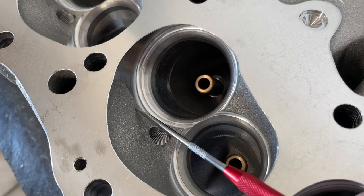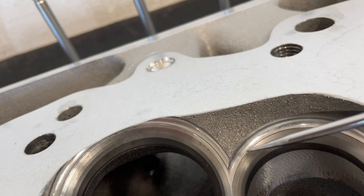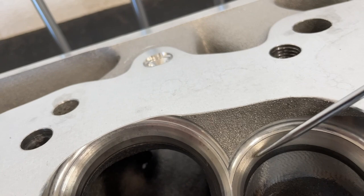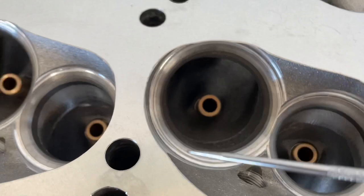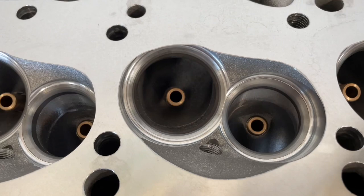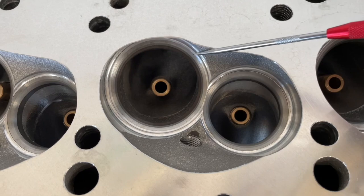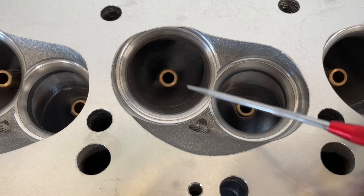When I'm porting them I'll blend this whole thing back for a much better design — blended in, and the poke-out here will be brought in and swooped out, so when the top cut comes in it swoops and isn't crowded by the chamber itself. The catch is these chambers from the factory are 119cc, so after you do the work they're usually around 122cc, and then I have to mill the head back to get to 119cc — but the chamber is still dramatically better.